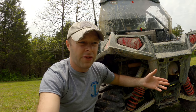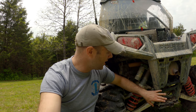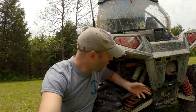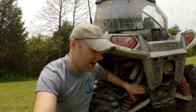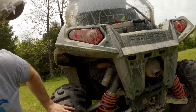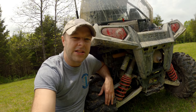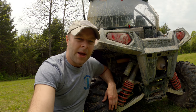There's usually absolutely no warning — it's just boom, and you're in for about a $1,000 repair on the differential. In online forums, it seems like about 20 to 30% of people have actually had this happen, and Polaris dealers essentially act like it's an unknown issue. There is a solution: you can get metal hardware and torque the pinion nut to the correct value, though it involves taking apart a large portion of the back of the machine — a fairly labor-intensive job. Some people may want to roll the dice and see what happens.